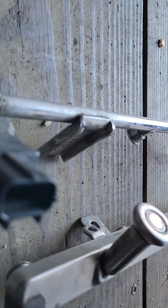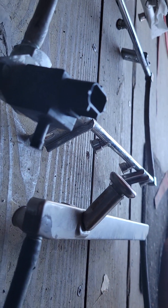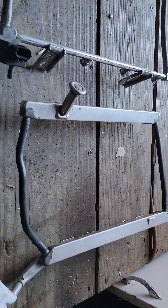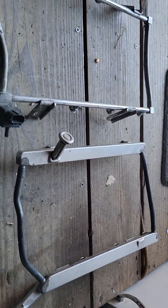With this one you would actually have to run return style fueling to use the fuel rail. The cool benefit is that you will have all that excess volume at the rail — it looks like it's double to triple the size. So when you're going with the fuel at the rail, you're just going to get a lot more with the Freestar fuel rails. I did figure this out myself two years ago, and since then I've just kind of been telling people, but now I'm able to have all three in a row.